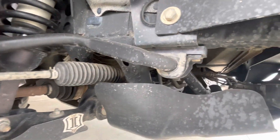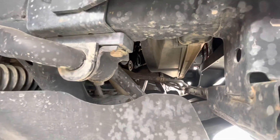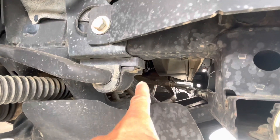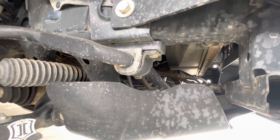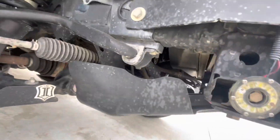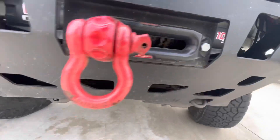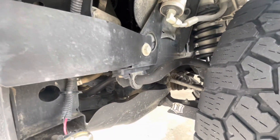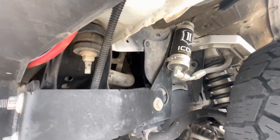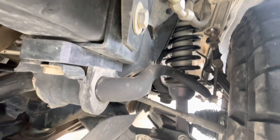Another good way, especially if you're down here, you kind of check for oil leaks. So when your water pump starts to go out, it'll actually leak at the bottom of it — it has a weep hole. So if you notice little spots of coolant that's kind of dripping in your skid plate, it's not good. Especially if you're going to go for a long trip, I would absolutely not risk it. So check, inspect, make sure things are good.